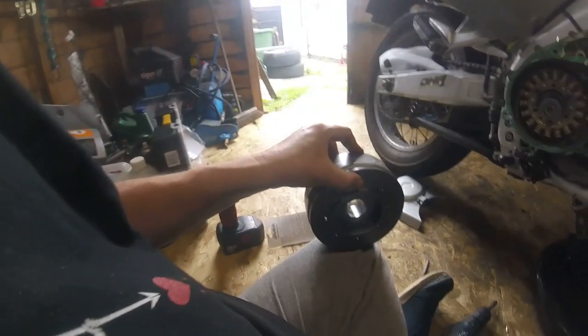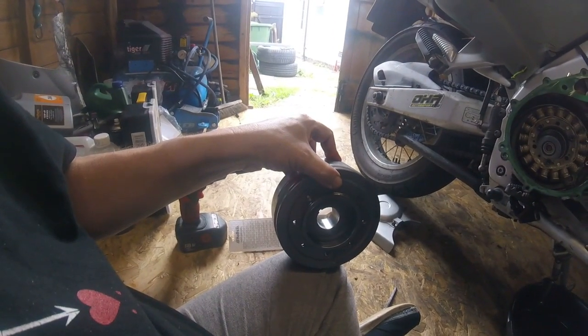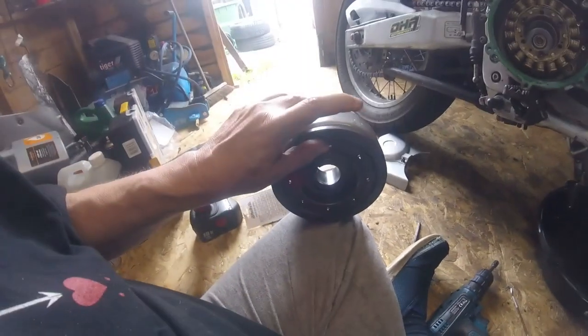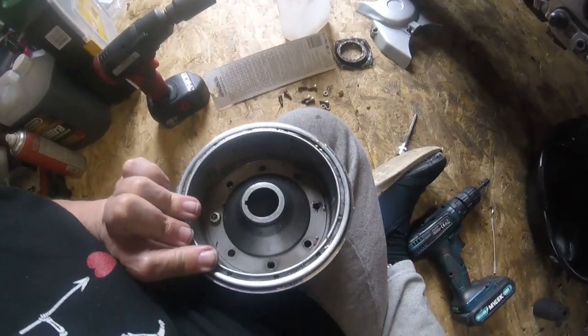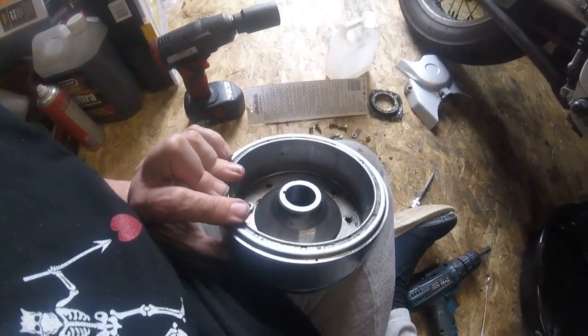Well, it appears that the inner hub of the flywheel is damaged, and if it's damaged, it means it can't fit on the taper properly, so it will never work. Fortunately, I do have one. I've got one stubborn little bagger of a bolt that's rounded the head off, so we're going to try and get the vice grips and get it from behind, and we'll replace that bolt. But this basically bolts this part of the flywheel to the stator wheel, and as you can see, all the rest are out. It's highly magnetic, and it's picked up all the shit lying around off the floor.